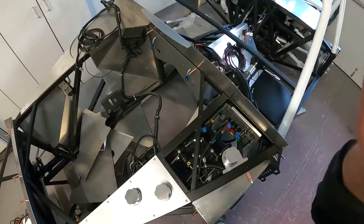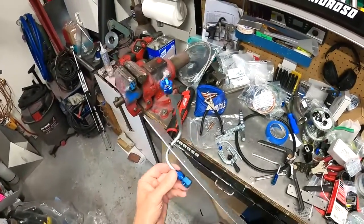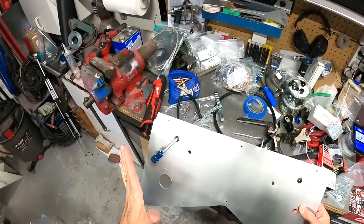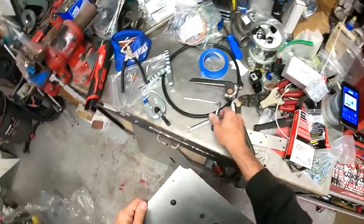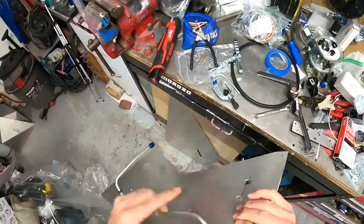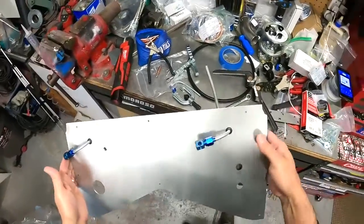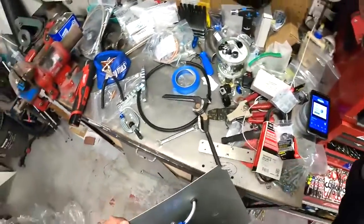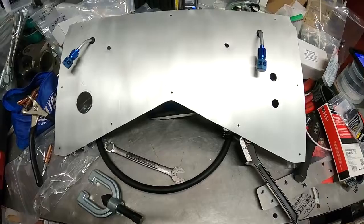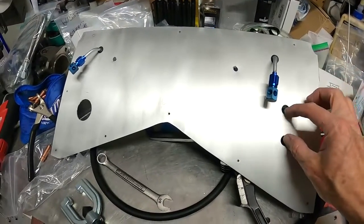The problem is I've flared both ends on this tube. I did this so once these things are in here there's no getting them off, because I wanted the whole small profile for a clean look. So I'm actually running this through the firewall plate and flaring it while it's on the plate - I just find it to be a much cleaner look. Both sides are now done and ready to tie into the T-fitting. It's a tight fit feeding the tubes through, but we'll make it work.